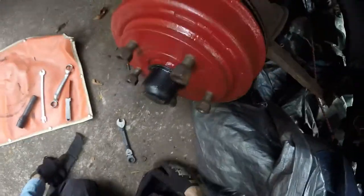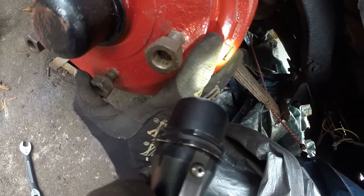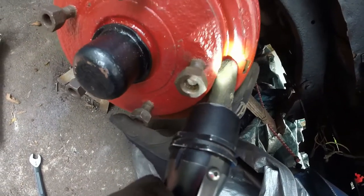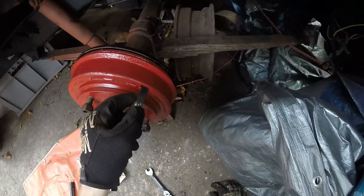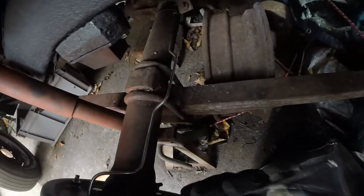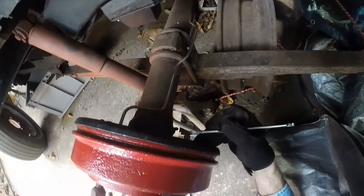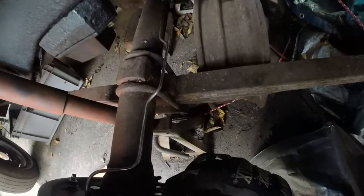So on the trailing edge, the brake pad starts a lot further down. And so I'm just going to use that flashlight to kind of pick up where it starts. And it's right about there. Again, 8/1000. Yep, I got it too tight right now. There you go. It's really too tight right there.